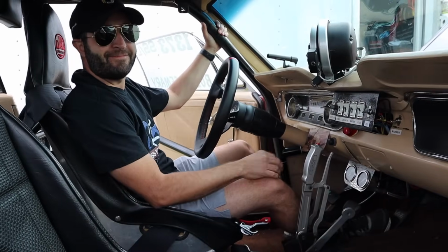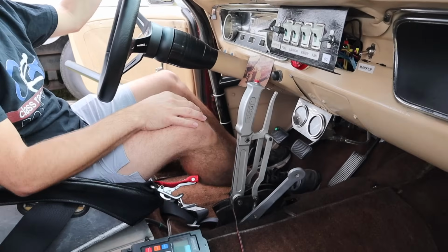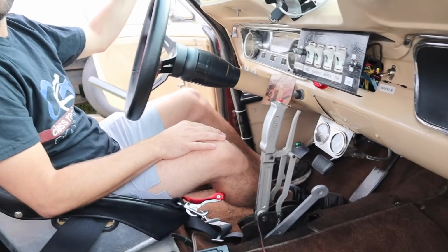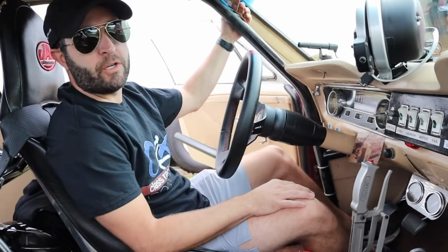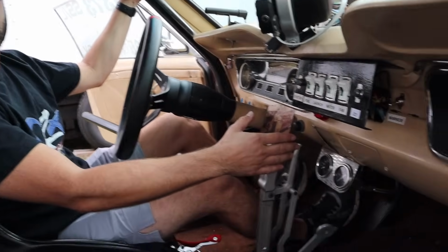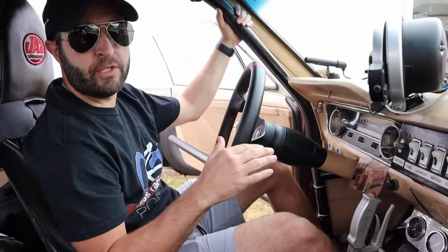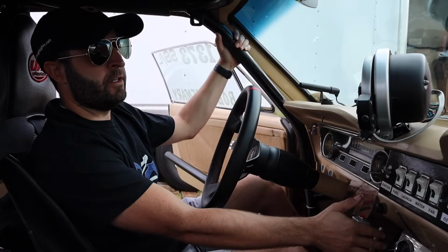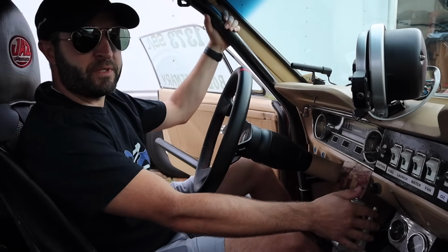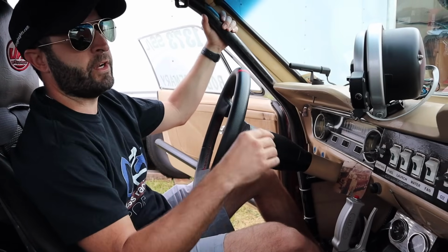All right, here's the cockpit of Bobby's 65 Mustang. You can see he's got the long engineering shifter on the 4-speed. You running a Jerico? Yes, sir. Cool. Jerico 4-speed. So when I roll into the burnout box in first gear, and I go 2-3. I do my burnouts in third gear. I don't shift during a burnout. And I bring up the RPMs, pop the clutch, get the tires spinning for a couple seconds. I don't do long burnouts, and roll it out.